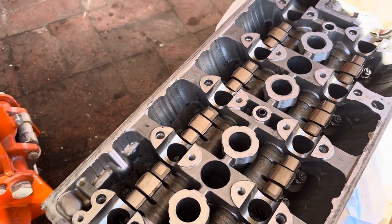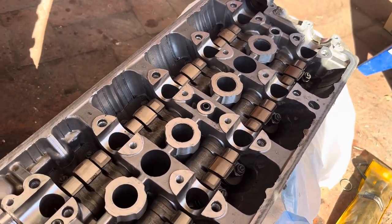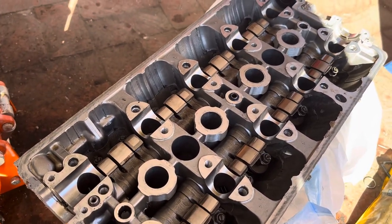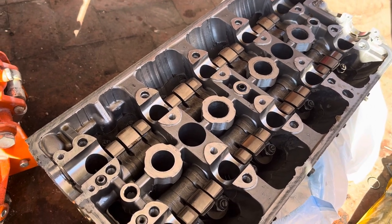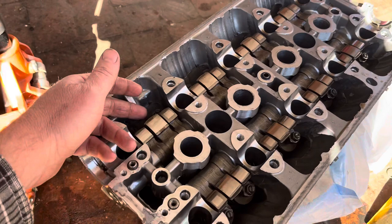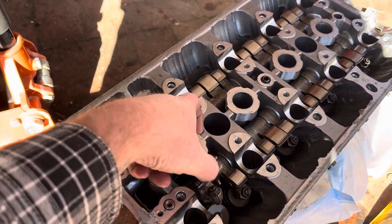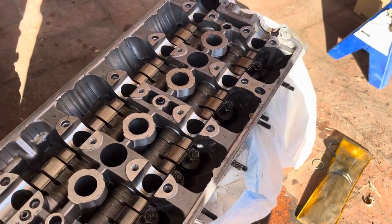So now I was really confused, because literally everything was fine. I could even rev the engine up and basically hotwire the solenoid in my driveway, and VTEC still wasn't working. So it was a mechanical problem. Then I checked all these, made sure the pins were in there, and the pins were in there.